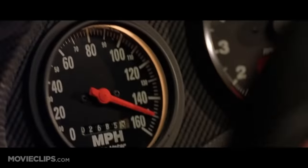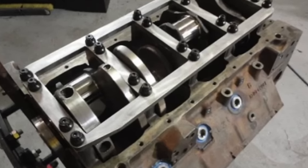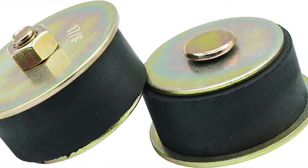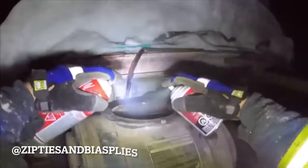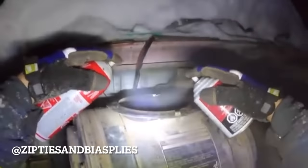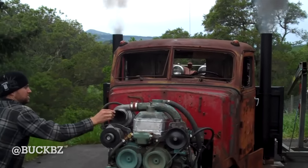had copious amounts of nitrous, spun up to 6,000 RPM, had a 6-inch thick main girdle, and endured so much block flex that they had to run rubber expansion plugs instead of copper or steel. This engine would not start on its own and needed ridiculous amounts of ether just to get going. Plus, it had an idle above 2,000 RPM in order to stay running.